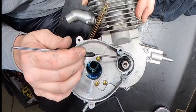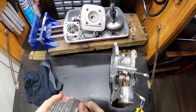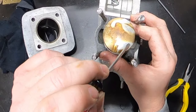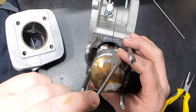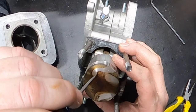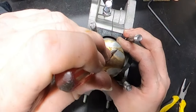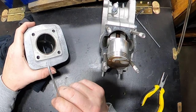I'm surprised it wasn't rubbing and getting worn down by the gear. Okay, so I just wanted to show you, since I got this off right now, so you saw coming up, going right out the exhaust, and then back here coming in, and it looks like it might have even been leaking up through the intake, and then swirling right here. Okay, this is exactly what was happening. And then here, right out. That's a shame. So that's one of the reasons why it was underperforming so badly.